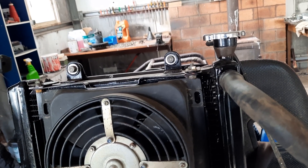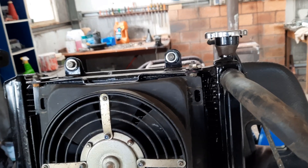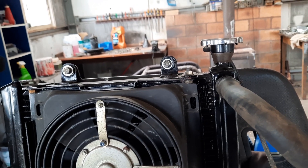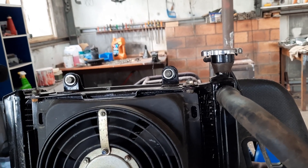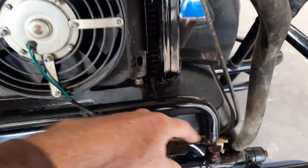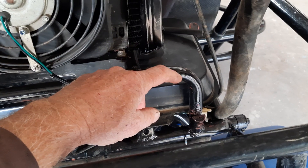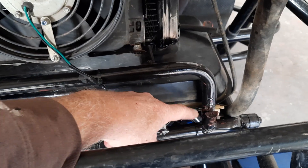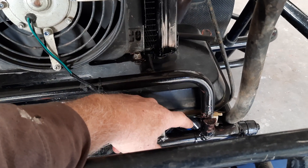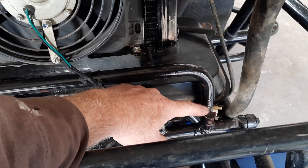I've got some of that epoxy ribbon on my car — on the pipe that goes onto the side of the radiator. I put it on there temporarily about four years ago and it's still there — hasn't leaked, cracked, or broken. It's good stuff. Rather than having the trailer clearance issue again, this time when we put it back in we unbolted the radiator and dropped it down out of the way — it only needs to come down an inch to fit in the trailer, but it's better than damaging it every time.